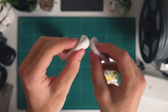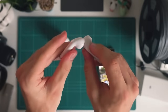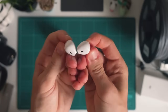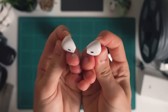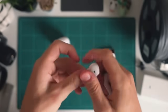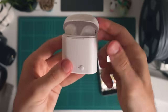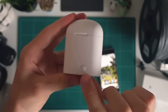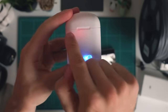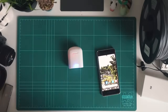Those pretty much are all the different functions on these TWS i7s earbuds. The other important function is the turning off function — if I just long press both of them you'll hear they've both shut down. Now you can just plug them back into the battery case, shut the lid, and if you want them to charge from the battery case you just press this button — you'll see the blue lights are on and they're red inside meaning they're actually charging, and now you can put it down somewhere and they will charge up.